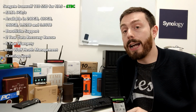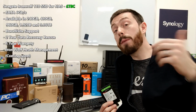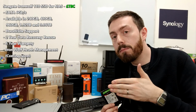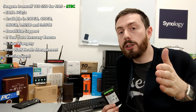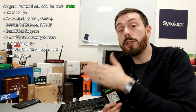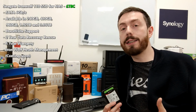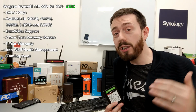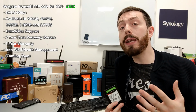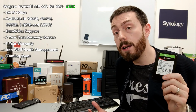These devices all support SSD caching. It's the ability to have numerous hard drives inside, all in their own RAID, RAID 5 or whatever, with that redundancy, but also to install 1 or 2 SSDs inside that provide a nice buffer to those hard drives. So with the read-write operations, frequently accessed data or common current access data is moved, and copied, I should say, to those SSDs. The result is that your reads and writes internally are drastically faster, and something that, thanks to techniques such as deduplication and auto-tiering, are only made the better. So if your NAS is getting a bit sluggish, or you're running a 10 GbE NAS but you don't want to fully populate it with SSDs, that's where SSD caching comes in.